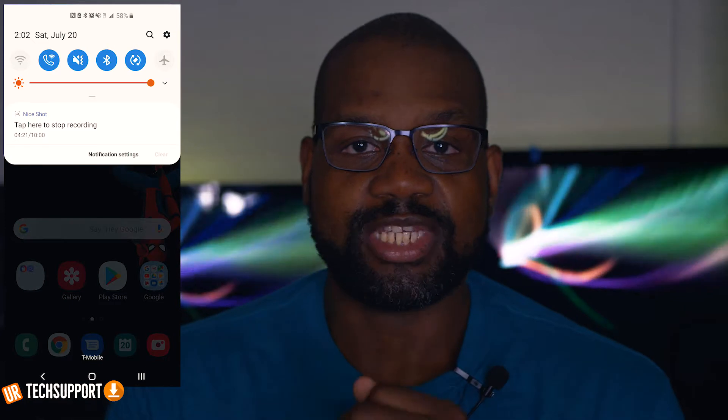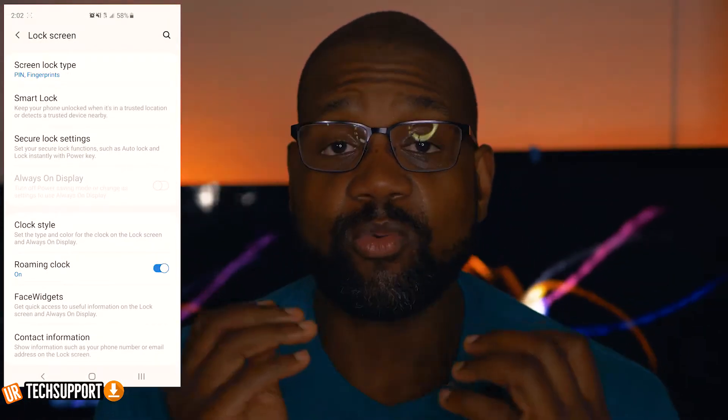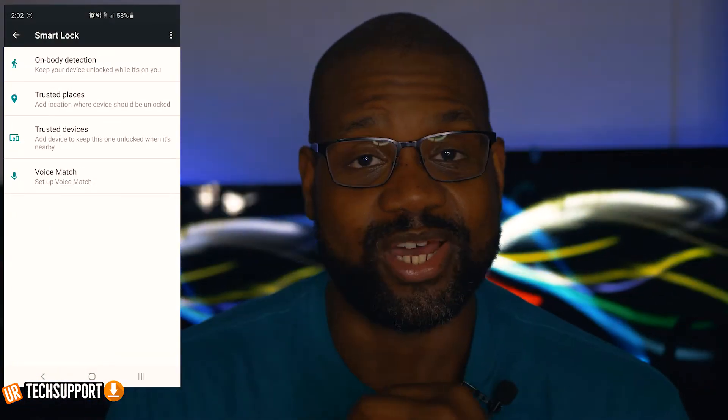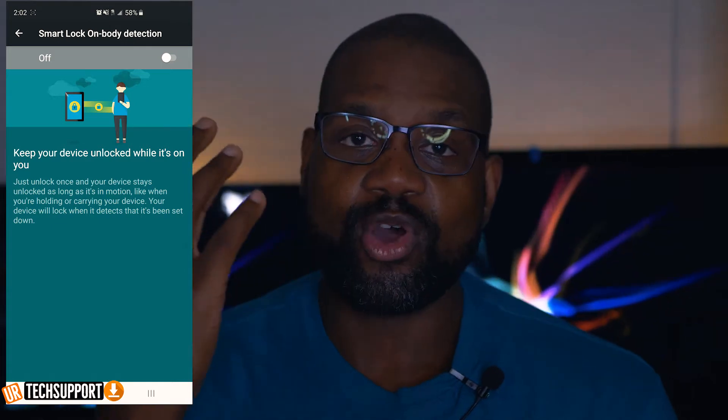As promised, here are some cool tips for your S10 and S10 Plus involving Smart Lock features that add intelligence and locational awareness to your phone — and there's also a setting here you may want to turn off if you're having accidental touch problems. Go to Settings, then Lock Screen, then tap Smart Lock. It'll ask for your PIN or security code. Once inside, you'll see four options: On Body Detection, Trusted Places, Trusted Devices, and Voice Match. The On Body Detection option should be turned off if you're experiencing accidental touches — if it's on, go ahead and power it off, then test your device.